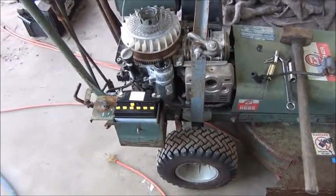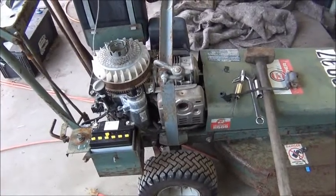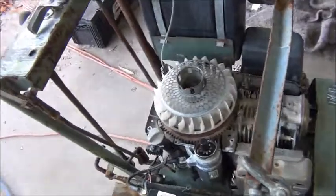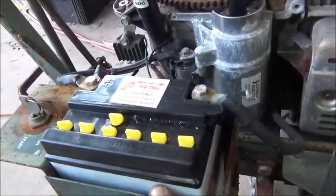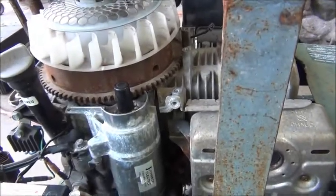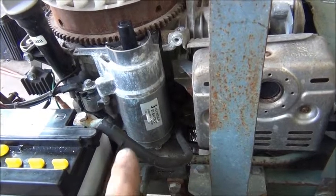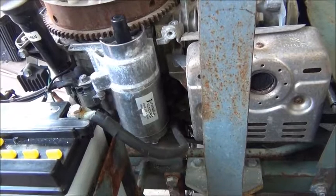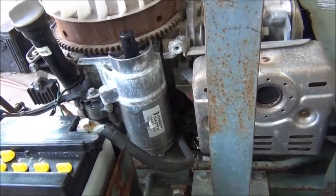They have a 13 horsepower electric start Honda, and this one wasn't electric starting and it had no spark. Only took me a very short time to figure out how to pull it apart. I bought a brand new battery from Goodchilds, chucked that in. Now the starter wasn't working at first - it was making noises like it was being driven by pulse width modulation and it was turning very slowly. I thought it was going to be shot, but I pulled it off and it's like brand new inside.